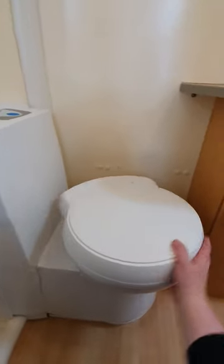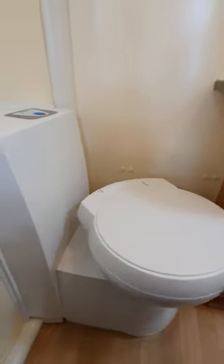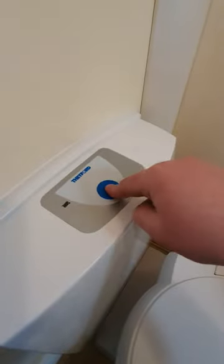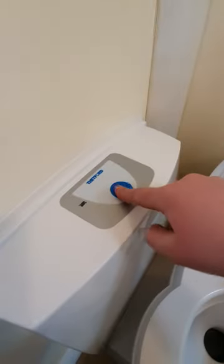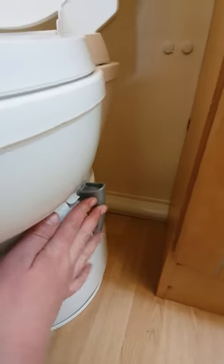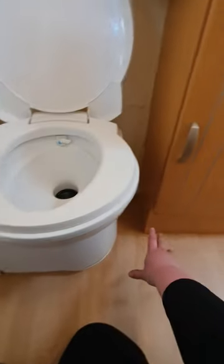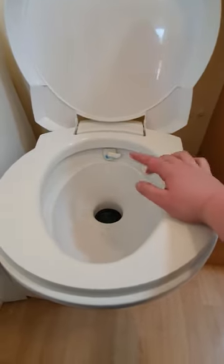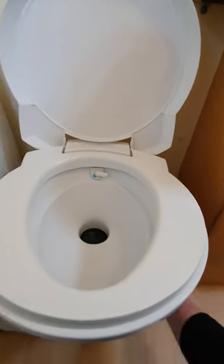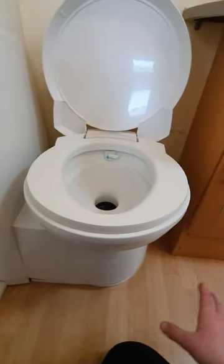Here we have the inside of your toilet — your toilet bowl does rotate. You can pop it right out of the way if you're using the vanity or the shower, and then you can adjust it to fit your legs in. Up the top here there is a little picture of a cassette — there will be a light that will start to flash at you when that's getting full. The big blue button here is your toilet flush — it'll flush from the back into the toilet. When you go to empty the toilet, there's a little grey lever here. When you push it back towards the wall, that opens up your toilet cassette, and when you slide it forward that'll close it off. It's really important when you're finished using the toilet that you close it. There is a seal in there that seals up and helps prevent smell, but your toilet cassette will not remove out of the locker if the toilet is open on the inside. If you go to remove your toilet cassette and feel a little bit of resistance, just jump in the van and make sure it's closed on the inside.